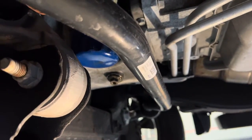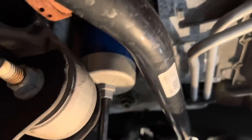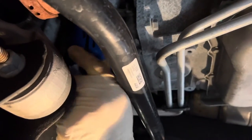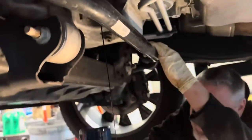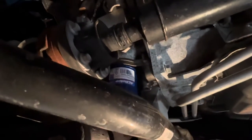We've got our oil filter wrench. We're going to let the filter drain down for a minute. We put some oil on our filter gasket and check to make sure the other gasket came down — the housing's nice and clean. Just want to make sure when you take the oil filter off, like Steve said, the old gasket isn't attached to the engine block, because that'll create a leak. We've seen that happen a million times before.